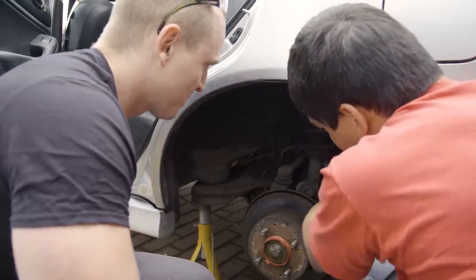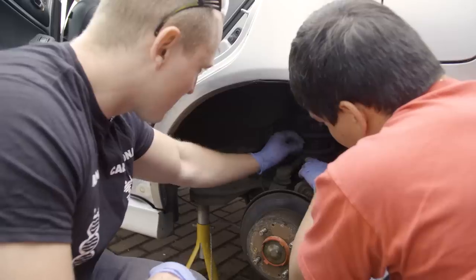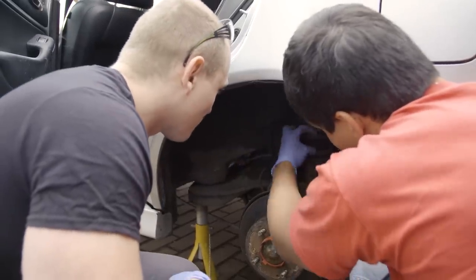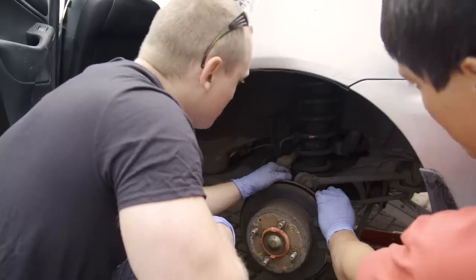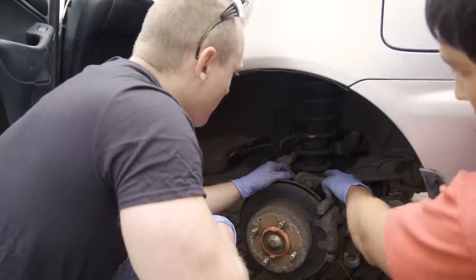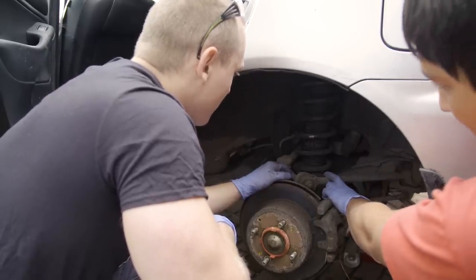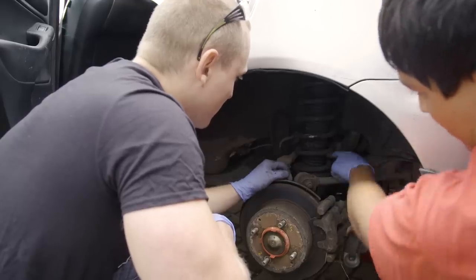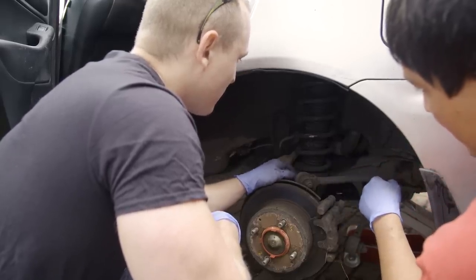However they've designed these springs, the bottom piece is flatter than the rest. The problem is the pitch changes — the pitch here is less steep than further up. You can see how it ramps up as it goes around. So either way, it's going to be bad.